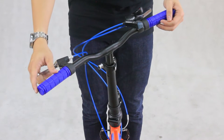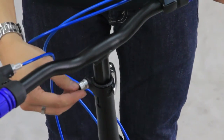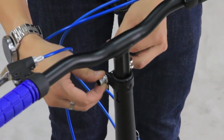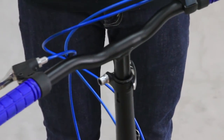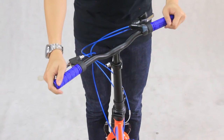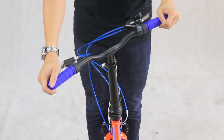Check the quick release latch on the handlebar. See if it is already tightened by twisting the handlebar. If it is loose, tighten it by turning clockwise on the quick release latch side after you unlock it. Check again — if there is a slight movement, that is considered normal. Then check the position of the handlebar; if it is still not perpendicular, we will move on to the next step.